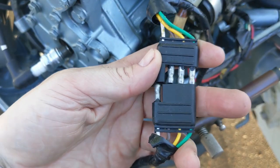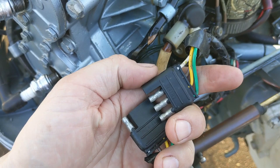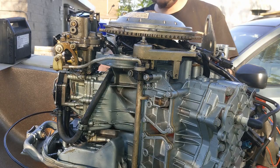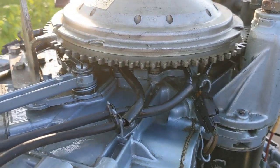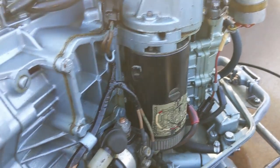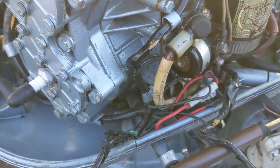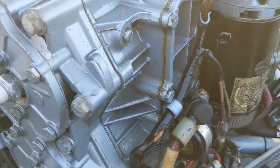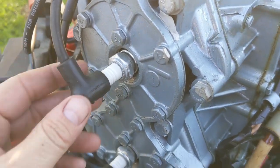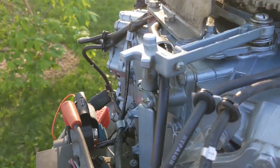I don't actually know what does what on this little key switch. The wiring in this engine seems to be wired through a trailer plug, which is weird. It does crank over if I jump it, so at least the starter's good — those can be expensive. I keep noticing more and more bad wiring in here, so I suspect I'm going to have to replace part, if not all, of this wiring harness, because it doesn't have spark when I crank it over. There's either something wrong with the ignition circuit or the spark circuit.